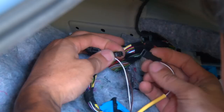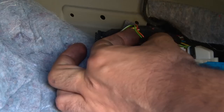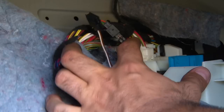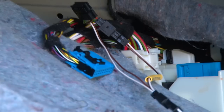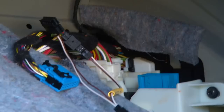To summarize the wiring: the two cables from the KW computer are plugged into the factory harness. The orange and green cables that originally went into the factory harness are now re-routed through the KW pigtail back to the DDC computer. The white and brown wires replaced the original pins in the factory harness. The signal is essentially being intercepted by the KW computer, modified, and sent back so the factory computer doesn't detect a fault.